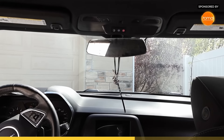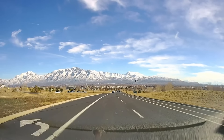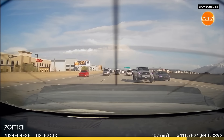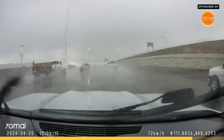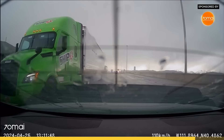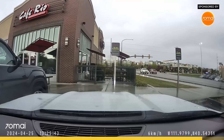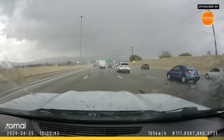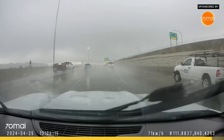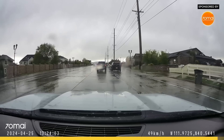We did another great installation. The main camera is right behind the rear-view mirror. The A800S has 4K ultra high definition resolution, dual channel recording, and is available with 24-hour smart parking surveillance. It has a built-in GPS with ADAS. The front camera has a 140-degree field of view and has the Sony IMX415 sensor that processes frames faster to deliver images with better clarity and vividness. The A800S also uses an f/1.8 aperture with night owl vision.